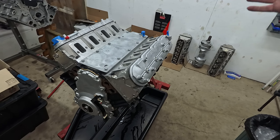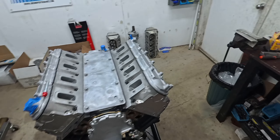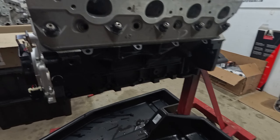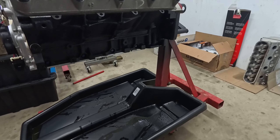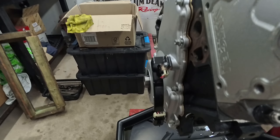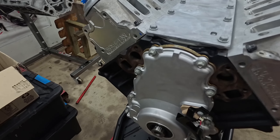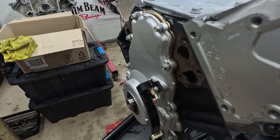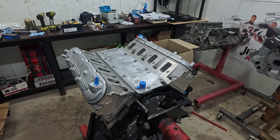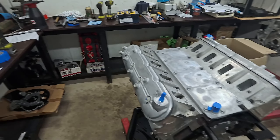She's mostly together — all the brand new cool stuff, fresh covers and everything. The sump that's here is old and dirty with turbo fittings welded in that aren't necessary, so he's bringing another one tomorrow. I do have to clearance the front cover to suit the dual row timing setup, but it's currently dumb-idiot o'clock on a Saturday morning, so I'm not getting the die grinder out. This thing is getting picked up in T-minus five hours, so I should probably shoot home and get some sleep.